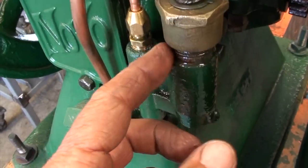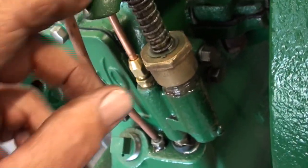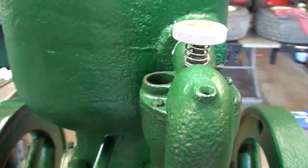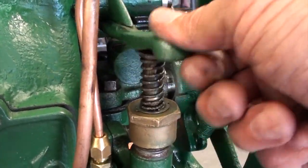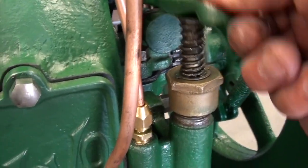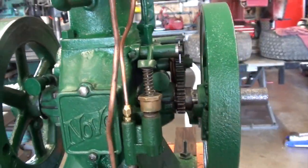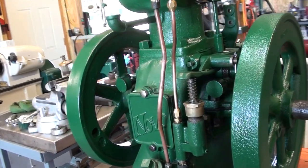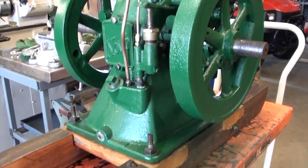So we've got a little bit of a leak here. I need to tighten the packing a little bit, and yeah, I think it's going to work, so we'll see what's going on here. Alright, got that tight and dry now, and she is pumping like crazy. I'm going to call that a fix. Need to get the mag on it, see how it runs. So thanks for watching.